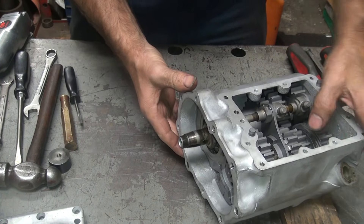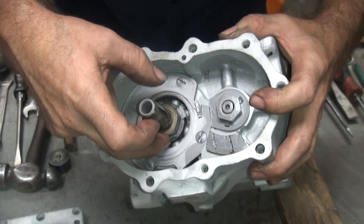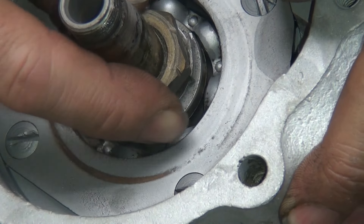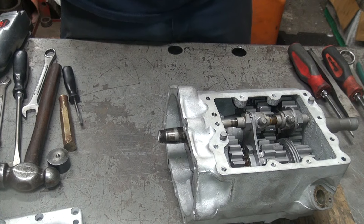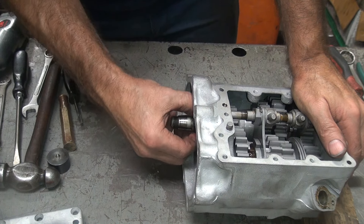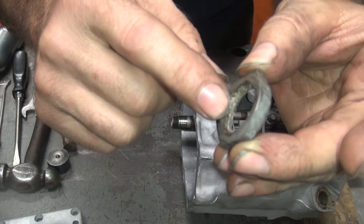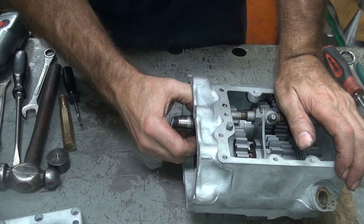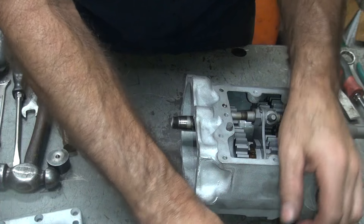The bearing is not bad — the problem is the nut came off. See how it's loose? The lock tab is still on there, but that did not keep the nut from unscrewing. So just because you have lock tabs does not mean that things don't come unscrewed — there's proof of it right there. That's why I use Loctite a lot along with a lock tab. Loctite is more important than the lock tab. That had like one thread on it, and you can see how the threads are all screwed up in here. This nut is wasted, and it's not even a normal size nut — it's a lot smaller than normal. I'm assuming this is stuff they did only for a year or two before they went to different hardware, because I've already seen that a couple times already.